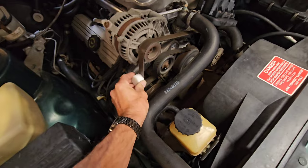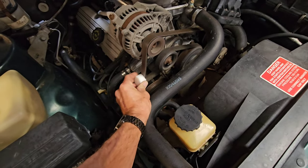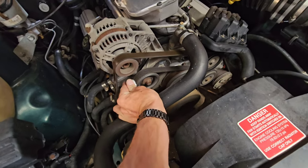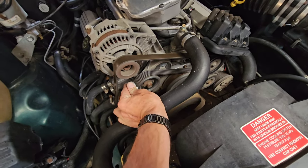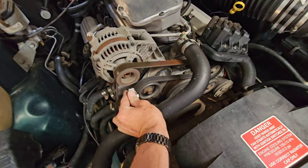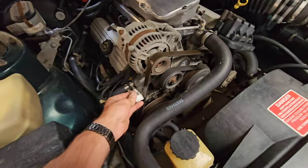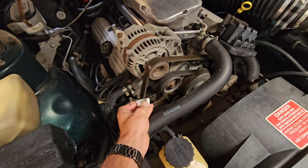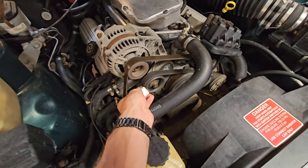So that squeaking is literally just from all the grease that we've run on the motor, all the degreaser. Listen to that, it's already gone. So just applying that wax to the belt, and there's nothing wrong with this drive belt. We can continue to use this. It'll pass roadworthy, no worries. Not really a roadworthy item, but it's going to be no worries at all for running this car in future.